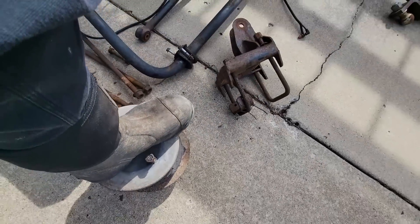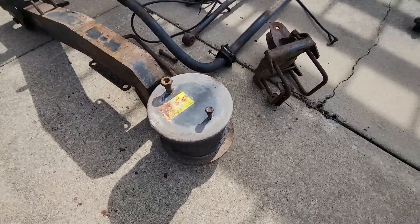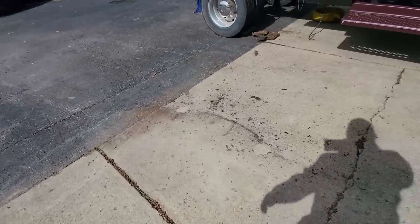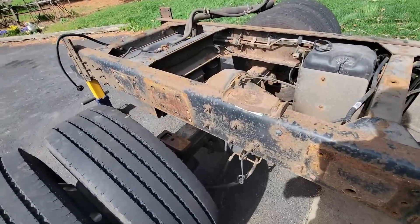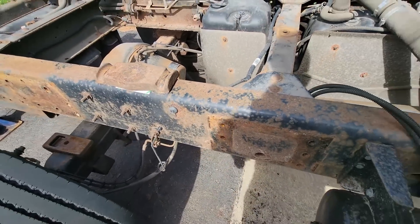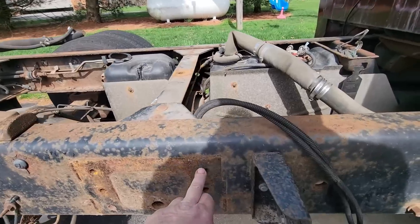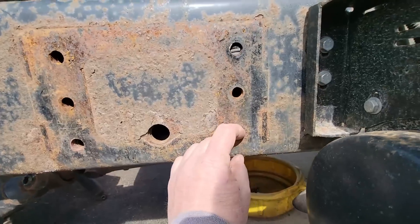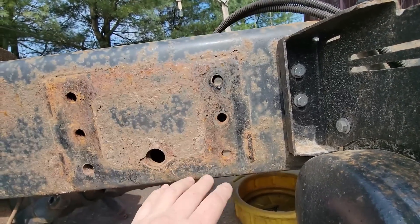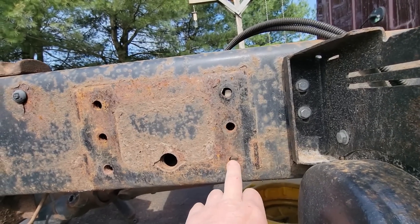You can see how short this arm is - I can barely compress this thing with my weight and I'm pushing 190 pounds. It's a very stiff bag. I think it could be improved upon. If I'm going to build a truck and move the axle, I'm going to build it with something better. This frame is only 8 and 7/8 inches tall, and everything we're going to look at will be about 10 and a quarter, so we have to be mindful of the brackets.